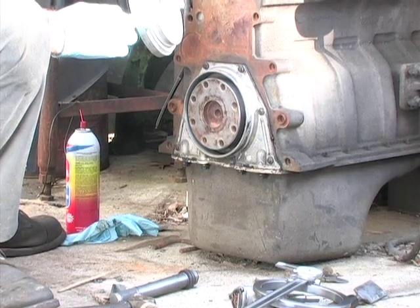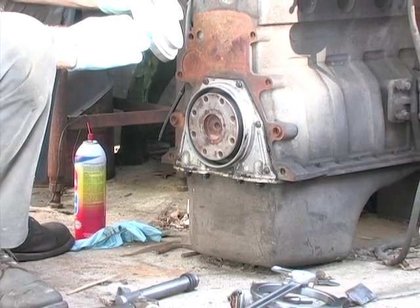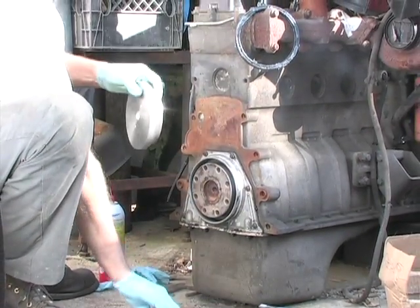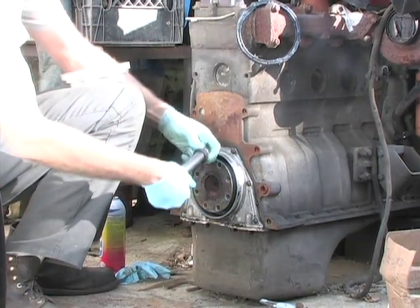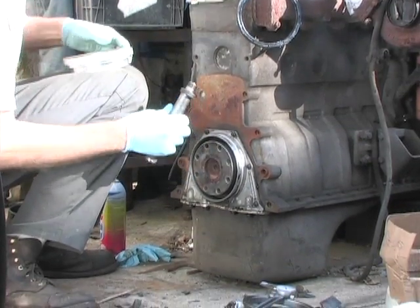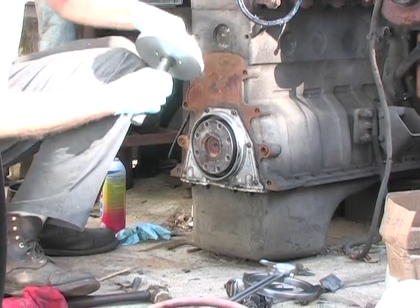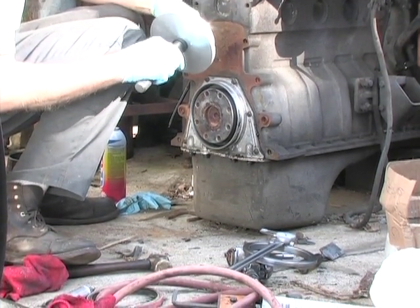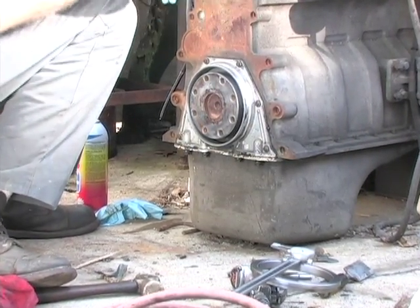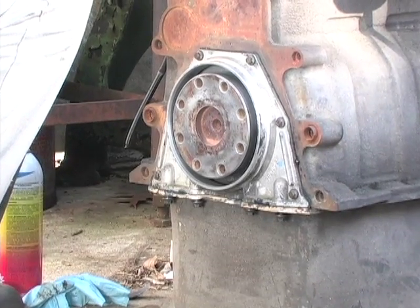This is where the seal goes. This slides over the crankshaft, and this ridge right here pushes it down, and then this last one stops it on the case. So we're going to take my universal tool here, a universal bushing driver, and put it on here. I made the hole 3/4 inch to fit my particular driver. If there was one that you particularly had and liked, you tell me about it. I just make it the size hole that you want, so you can use yours.